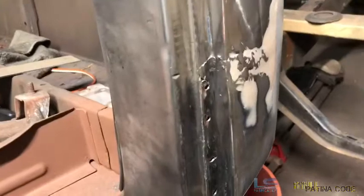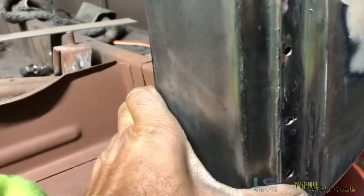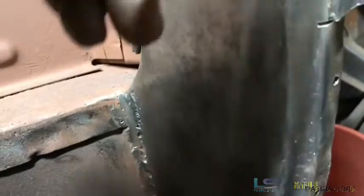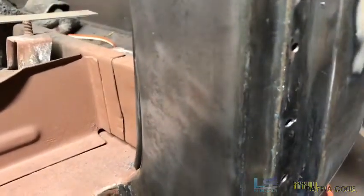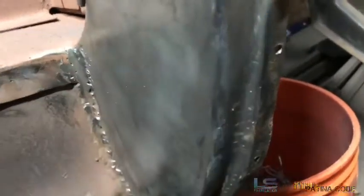I've removed the door. You're going to see these holes from where metal tapping screws are — they installed the cab corners and held this end in place with metal tapping screws. Sometimes people do that to hold panels in place, but then they never finished. We backed out the metal tapping screws. You can see they were a little rambunctious — they gouged into the lower B pillar here. From my best guess, in order to get this to move inbound, we're going to have to take this flange and move it inbound because that's what's making it protrude. There's no other reason.